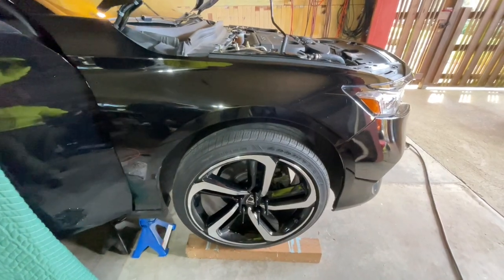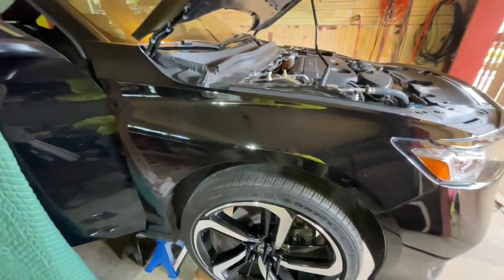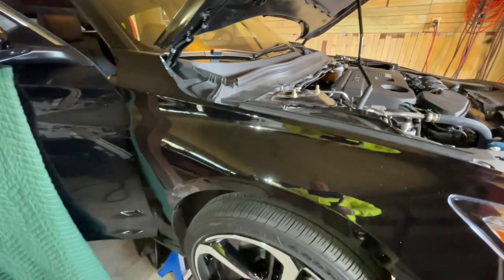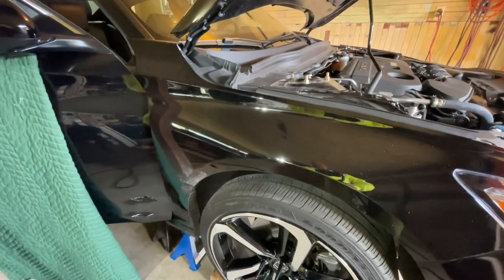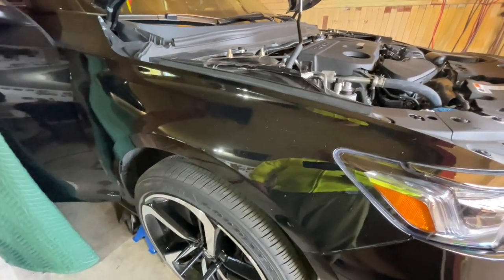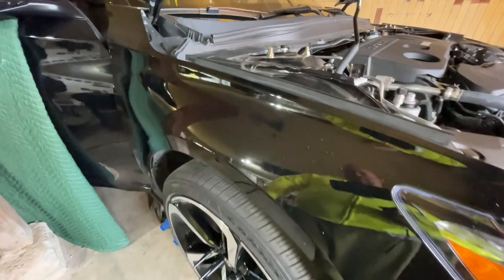But it's a good idea, before you put some weight on the car and before you actually do your calibration, to figure out all these things so that you don't cause damage to your car. I had it at -1 degree camber on the setting there on this little top plate. That didn't work out. It was a little too tight on the fender for my taste, so I put a couple more degrees in there. So we're sitting at about -3 degrees of camber, and torqued everything down.